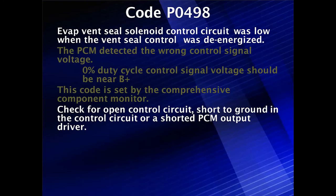We're going to check for an open control circuit and a short-to-ground. If it's open, we won't see battery voltage — it'll come out low. A short-to-ground in this circuit will always be drawing current flow. A short-to-PCM will always be drawing current flow. So we're going to look at both current and voltage.